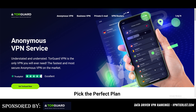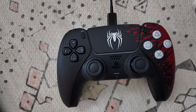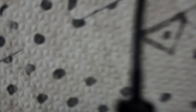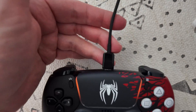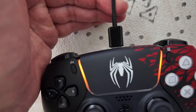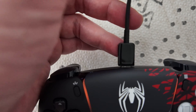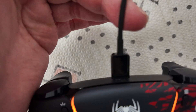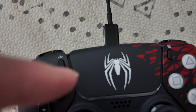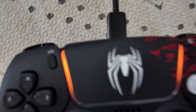As you can see here, we have the orange indicator light on the controller. One of the key things I wanted to talk about is this USB cable — I believe this is the one that came with the PS5 specifically, and this is what caused me a lot of issues. If you're using any generic USB-C to USB-A cable, it might not have enough data transfer capability, and when I plugged it into the computer it actually wouldn't register the controller.